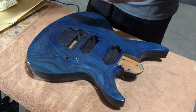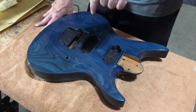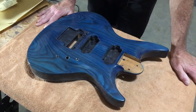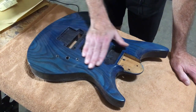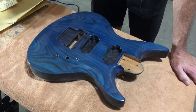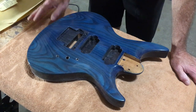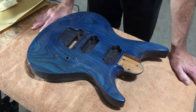All the products that I'm going to mention, I'll put links to those down in the description below. Just click show more and you'll see those links and you can go check them out yourself and decide if that's the route you want to go. The technique that I'm going to use to level sand this is a dry sanding technique. I stopped wet sanding years ago because abrasive sandpaper technology has improved so much in recent years that you can get great results dry sanding.